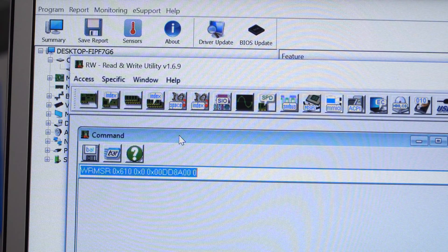So what I had to do was run a read-write utility. What this does is allow us to overwrite via software — it's basically reading the RAM and we're just changing that power limit. This is the same hack we used for the Apollo Lake N3450 processors and it works quite well, and it's good to see that it is also working with Gemini Lake.